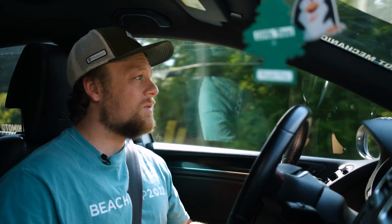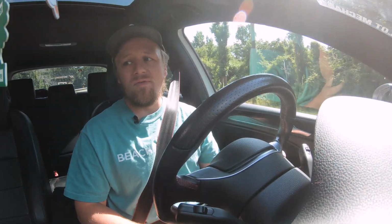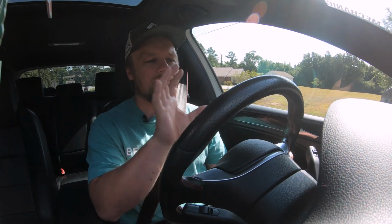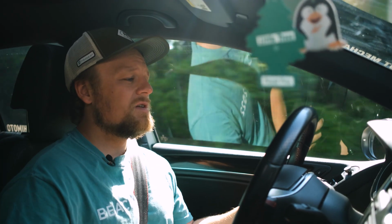I've got an idea. Because the passenger side tip does not fit perfectly in the slot for the rear valence, I'm gonna see if maybe adding a couple washers as spacers, bringing that down just a touch, will get it off anything that's rattling back there. We're gonna actually do it on the rear hanger, and we're gonna be doing it on the hanger in the middle, just to get it kind of off whatever it could be rattling on, because I think it's rattling on some of the rear suspension components just underneath.